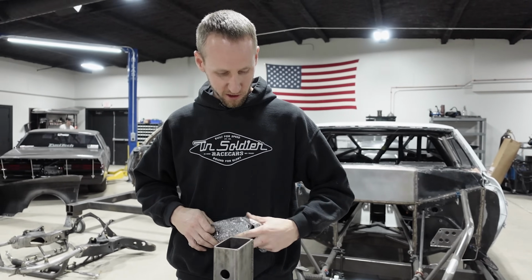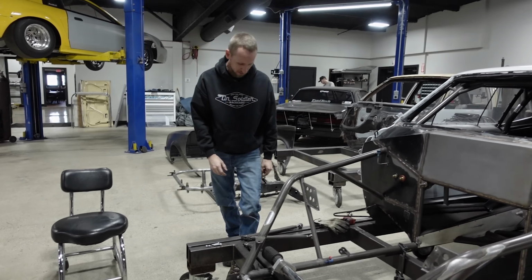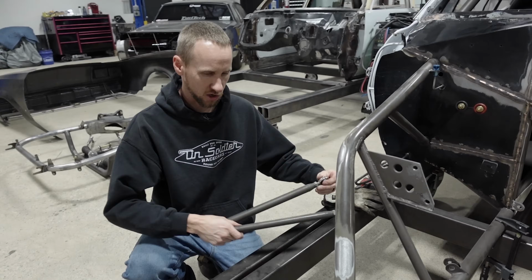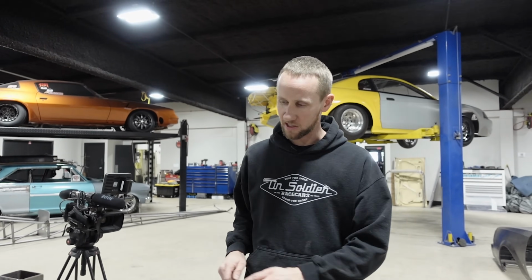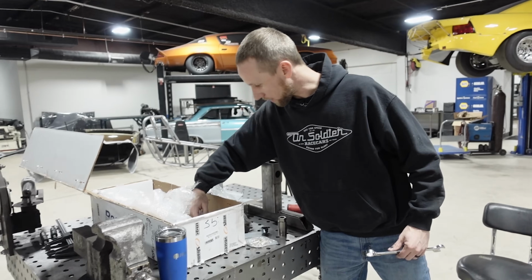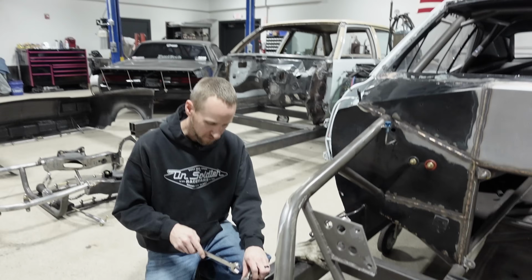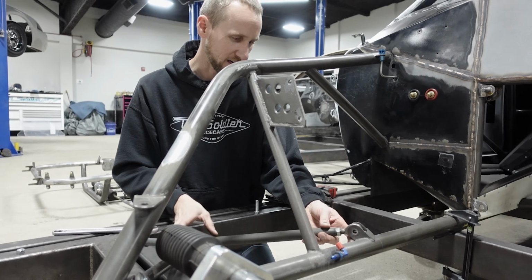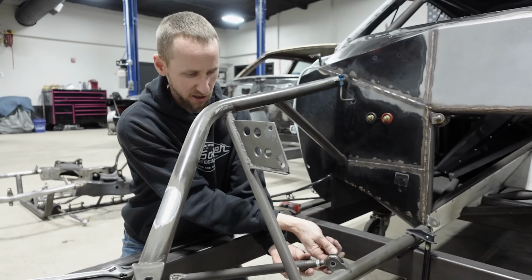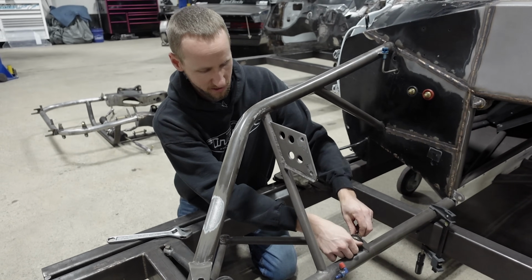Here's the steering arms and the studs for the bottom. I'm gonna try to reuse his old lower control arms, so these are the ones that were already on the car. Got you. The kit came with pieces to make new ones, but they're the exact same as those. No need to use them? Yeah, hopefully I can just use these and I don't have to make a new set. I was just trying to make them both have about a 1/2 inch of thread showing, so that way I got adjustment in and out. Always better to start in the middle. Gotcha.